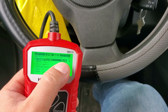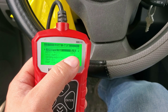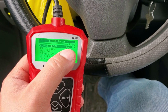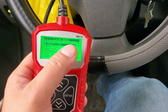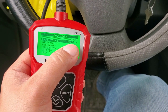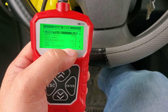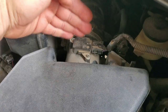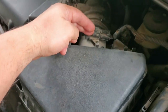Just to give you an idea: if you see a value of anything over 10 or under negative 10, there's a problem. In our case, since I was seeing 12.5, I was under the impression the vehicle may have an intake manifold leak. One thing that could be happening is from this point — this is your air box, this is your mass airflow sensor.